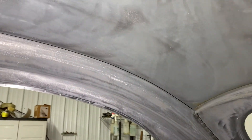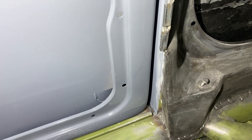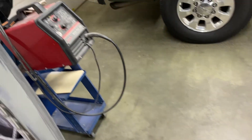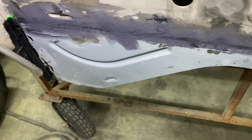This will get a light coat of epoxy primer on the inside. I still got to weld on some pieces down there, sand the dash — I still got some more to do — and then after that seam seal it, and I should be good to go in here. Then I just got the outside to do. I had some extra short strand fiberglass and I put it over that seam where I seamed that firewall on the outside, so I'll sand that and you won't even see it when it's all said and done.